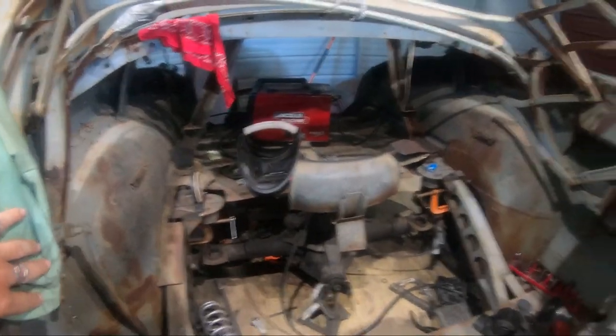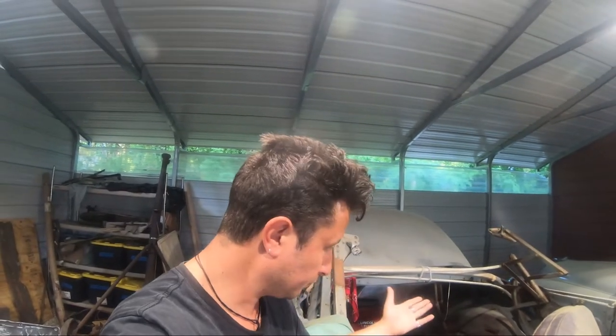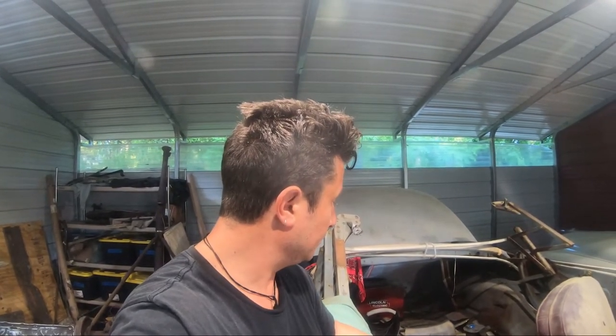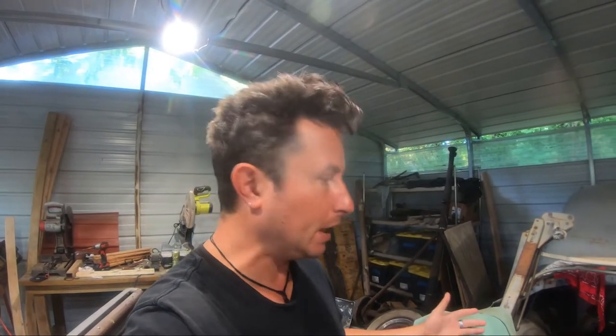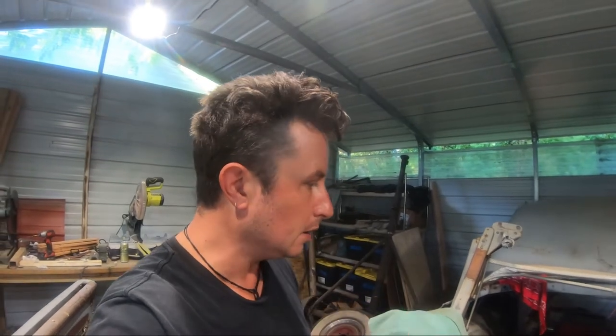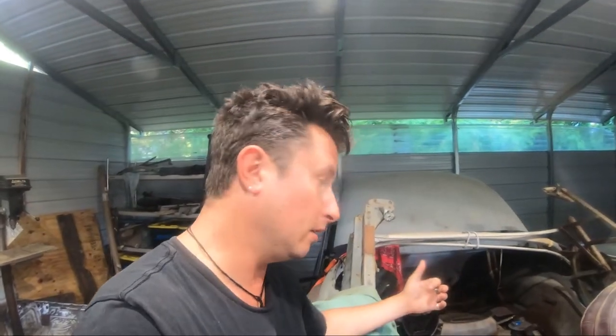I spent a ton of time ruminating on this, and I even put it down for about six hours after I got these two pieces clamped in here. I just can't really think of a better way to do this outside of somehow moving this project to a flatter surface. I think this is as good as it's going to get. I've never done this particular type of rear end install. It's still kind of hard to locate an axle on a frame like this because there aren't a lot of places to measure from. Anyway, that's the nerves talking. We've got to tack this in well enough to support the weight of the car, and we'll finalize those welds once we're certain we're satisfied.